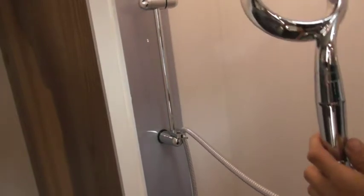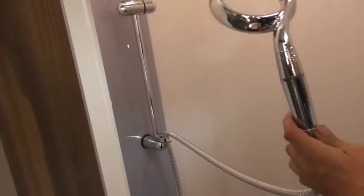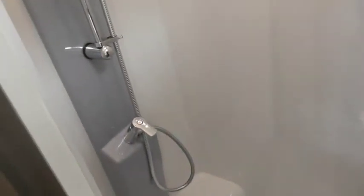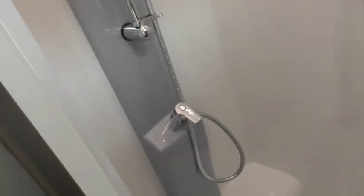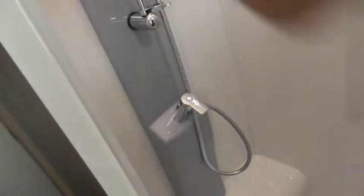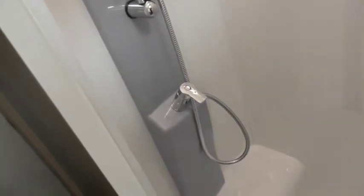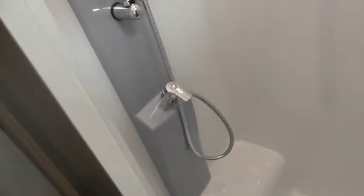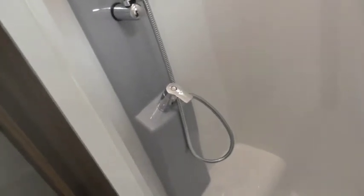Be very careful in winter — any water trapped in here is plastic, and water in caravans can cause damage if it freezes. The best thing to do is take the shower head off and drain it down for winter. Same with the mixer tap — these are the two taps you need to check before switching the water pump on, because if they're open for draining and you switch the pump on, you'll have water everywhere.